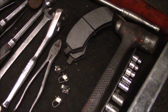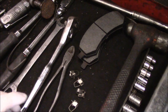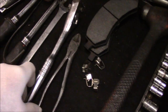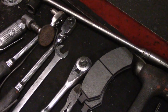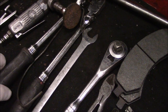This is what you're going to need basically to get the job done. Obviously you're going to need new brake pads. We are going to change the rotor, which I have down here on the floor. We need a hammer, a set of metric sockets, and we are going to change the hardware. We need a pair of cutting pliers to remove these clips because we're going to cut these off and throw them away. We're going to use a half-inch ratchet because the bolts on this side were extremely tight, so we'll use a breaker bar and a half-inch drive ratchet.